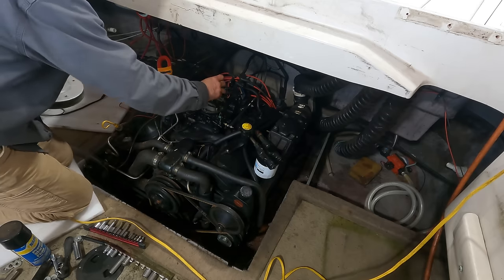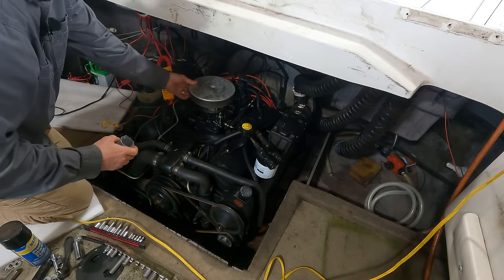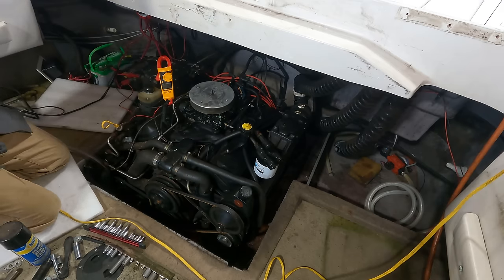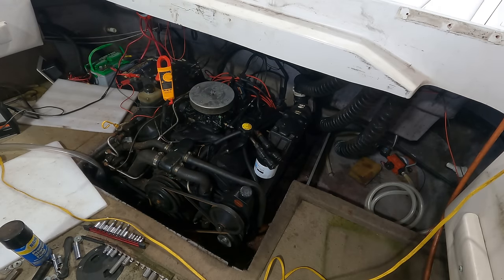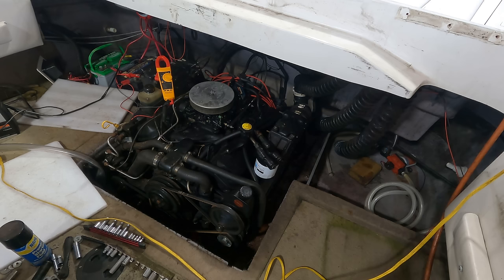So I'm gonna do what he suggests before I start all the engine troubleshooting. He said, dump some more fuel in the carburetor, and we're gonna give it plenty of throttle, which I was not doing yesterday. But all right, let's see what it does. Just doesn't seem like it's cranking well. Seems like it ought to do better than that. Now that starter might be damaged from it trying to spin a locked up engine. That could be the issue.